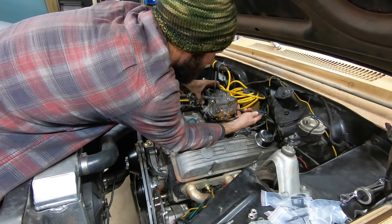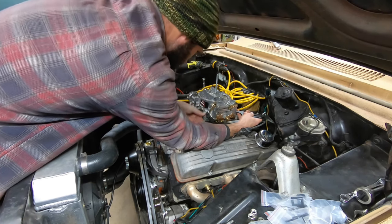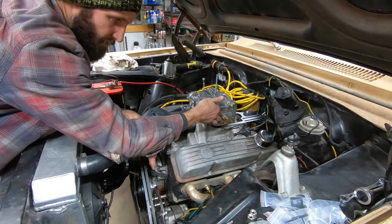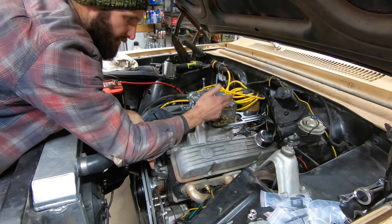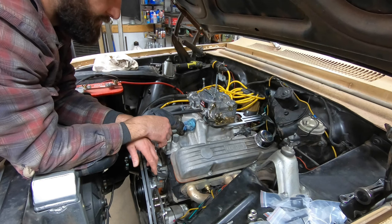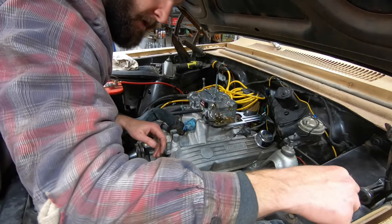Oh, and our gas pedal's getting, why? Yeah. Well, that's already a problem. I mean, it clears here, which that was the problem with the other bracket, is it wasn't going to clear the pivot area of this carburetor. But this one hits our gas pedal. So what we could probably do is figure out where our TV cable's got to be, which I think is going to be up in this region, and then cut the back of it off. I think that sounds like a good plan.